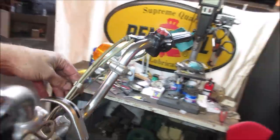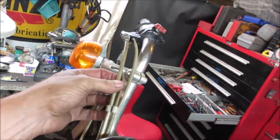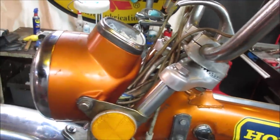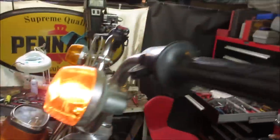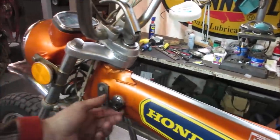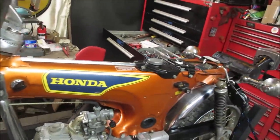Will that be the wire that I pulled? No, that was this one for the brake light switch. This is going down the center of the handlebar and runs through into the headlight. There we go. I don't have extra wires. We'll see what happens when we fire it back up again. We'll deal with that later. Tail light, brake light works. Let's go shut power off, and possibly those may start working too once it runs a little bit.